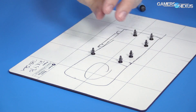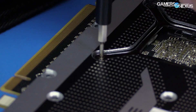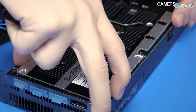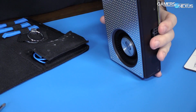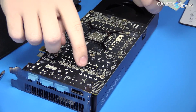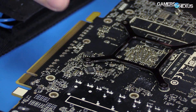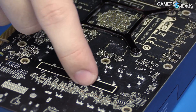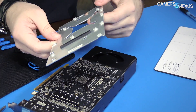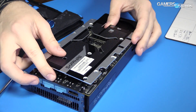There are quite a few small screws here. For these I'm just going to do opposing corners as we normally do. The back plate looks like it's actually loose and can come off — a thermal pad was hanging onto it. This looks like where the VRM is. You can see the chokes or inductors on the other side of the card, we've probably got a capacitor bank on the opposite side, and the MOSFETs are probably right there — that's almost certainly why the thermal pad was sitting there. The back plate is just a piece of metal with a thermal pad, and there's a small window cut into it.